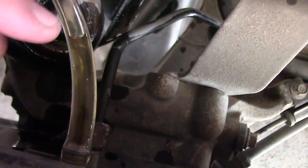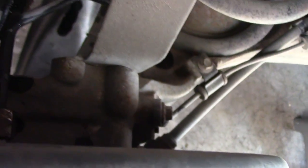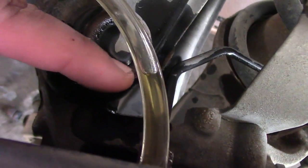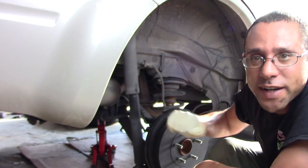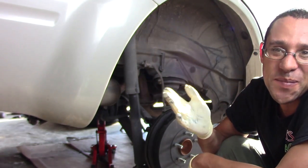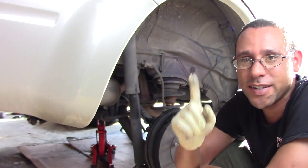The last step is to bleed the brakes. I have plastic tubing hooked up draining into a water bottle that already has a little brake fluid in it, so I don't introduce any air bubbles. It drains loosely into the bottle so I can confirm there are no air bubbles and the fluid coming out is clean. I start the car, pump the brakes, and watch the reservoir to make sure it doesn't get too dry while fresh fluid moves through. Cleaned up the drums, adjusted the brakes, bled the brakes — about half an hour's worth of work. These drum shoes last the life of the car; all you have to do is adjust them. Thanks for watching — ride safe, drive safe, and keep at least two wheels on the road.